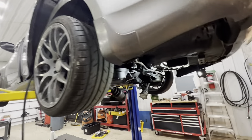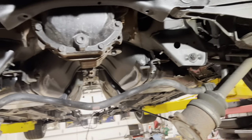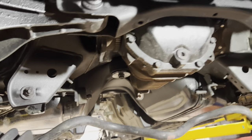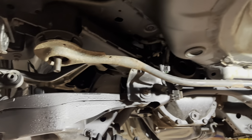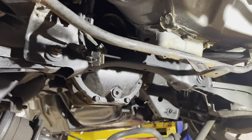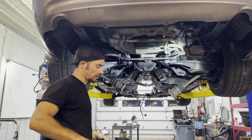The rear subframe is in now. I just have to torque the bolts down — I think the spec is about 90 foot-pounds somewhere in there. Letting the axles hang and bolting them up, because we're going to do axle spacers on the flanges — obviously when this thing's sitting low you're going to have a gap there. Let's get the torque wrench out and get this installed the right way. Can't wait to see how this rides with the Z1 bushings — it should be pretty sweet. We'll get this bar cleaned up, though it's kind of a piece of crap anyway.